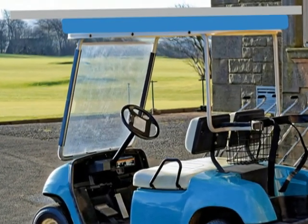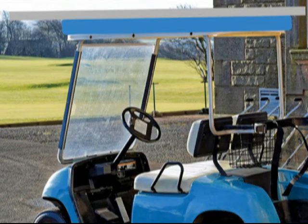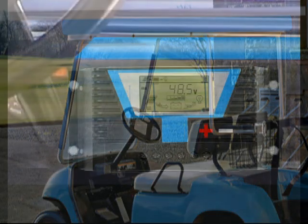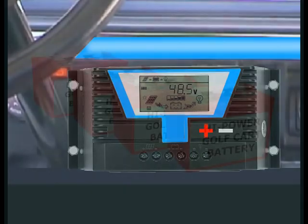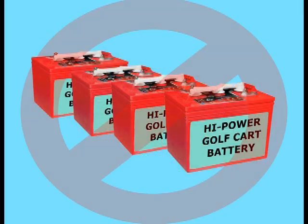There are a couple of things you would need to add to the golf cart: one of them would be a 315 to 450 watt solar panel, and the other is a simple charge controller, also available at a low cost. You would not have to buy any additional batteries, since the golf cart already has them. An inverter is not required, as the batteries need raw direct current for recharging.